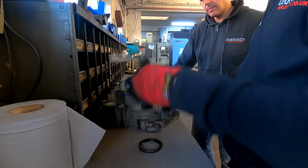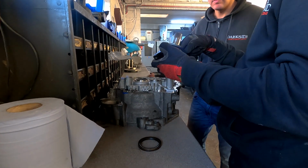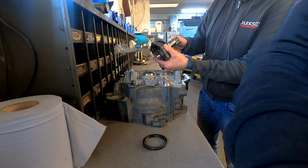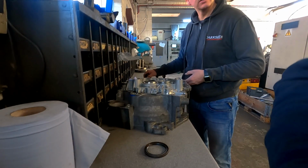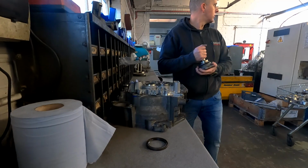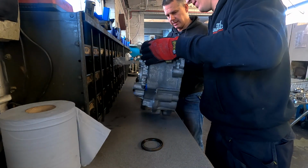So that's the seal. Paul just wants you to, if you can, just take that all the way down to that. Just machine that sleeve away. Yeah, but just take that chamfer away inside there if possible. That's one bit then. Is that all it is? No. If you can't do that bit for any reason, we can sort that. And then the main thing.